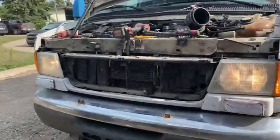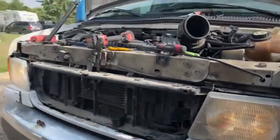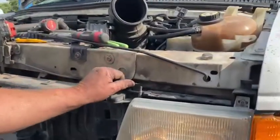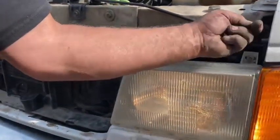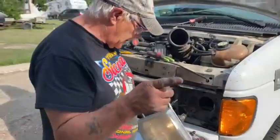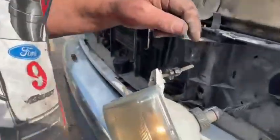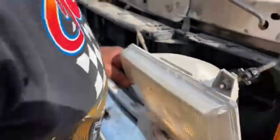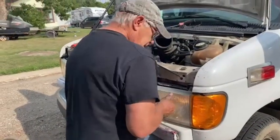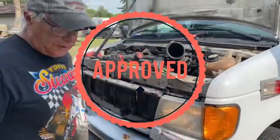So we've got everything going - that's high beams. If I didn't cut that wire, we would have never had high beams. So we've got high beams, turn signals, and low beams. To get these headlights out is super easy. All you do is push this back and lift it up, then pull the headlight out. When you change the bulb, don't touch the bulb with your fingers - very important. Put a little bit of spray lube on there, then put it back in there lightly - don't push too hard - and Bob's your uncle. See, that's all there is to it.